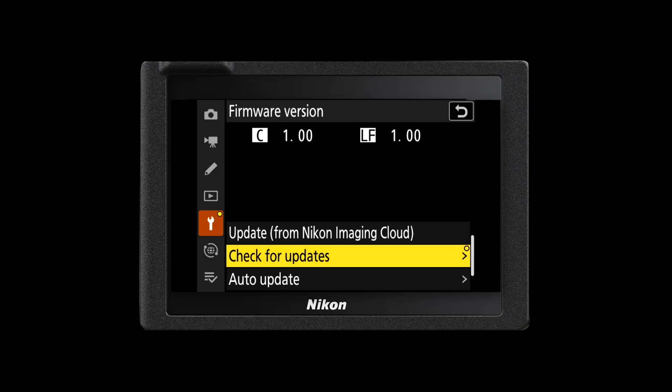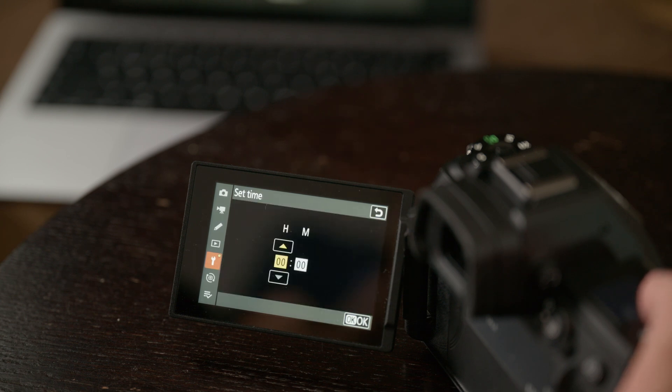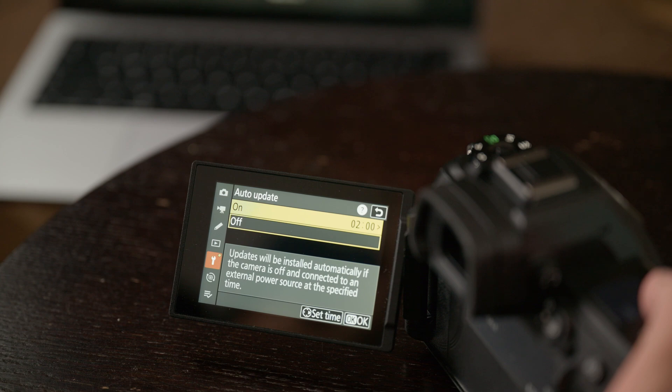When it comes to firmware updating your camera through the Nikon Imaging Cloud service there are a couple of different options to make sure the camera is only going to update the firmware when you want it to. First of all you can prompt the camera to check for any new updates, then download that update and proceed to update your camera when that's right for you. But you can also allow your camera to automatically apply updates at a given time — whether that might be nine o'clock in the morning or maybe at midnight — a time that you are less likely to be using your camera. In order for your camera to perform an automatic firmware update it will first need to be connected to the Nikon Imaging Cloud, meaning it needs to be connected to Wi-Fi, and it will also need to be connected to an external power source at the given time you've requested the camera to perform the automatic update.